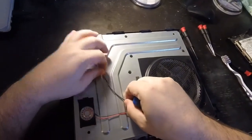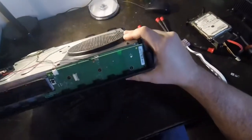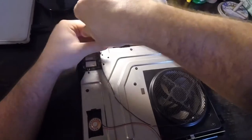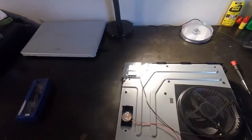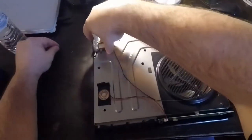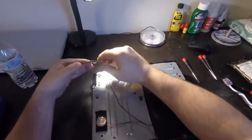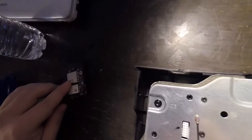You are going to want to disconnect the wires — the wires at least. The other one disconnects on the front right here. You have to take the wireless card off first, which I'm taking off now. Take your time, don't get too excited or scared — it's just an Xbox. You pull it up kind of evenly because it's actually attached down there with a little plug-in. See how it kind of plugs into the top of that.